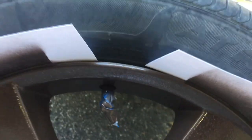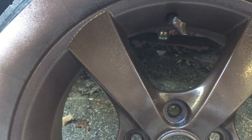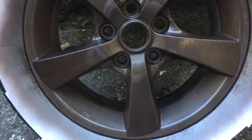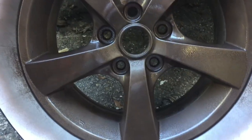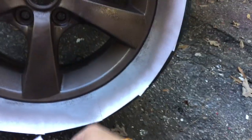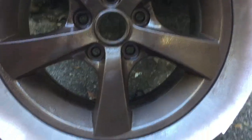The cool thing about this — I will have to peel the tape off right there, but when I'm ready I'll just take it off like that. You can see it will have a clean edge right there, but I'm never going to see that. I chose this color because I was looking for a bronze and they did not have a bronze in this paint locally that I really liked — everything looked a little bit too light. I wanted something a little bit darker and something gloss because it has better protection for the surface. We're going to do another coat after about 15-20 minutes.